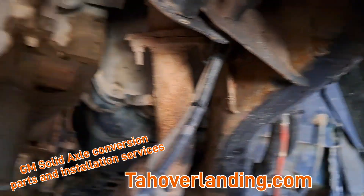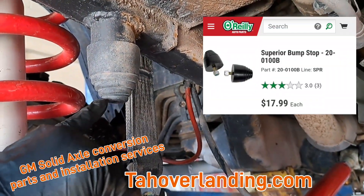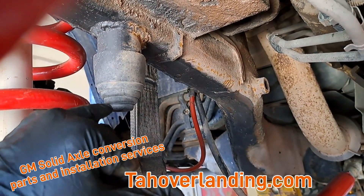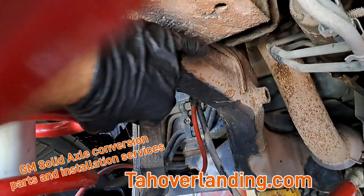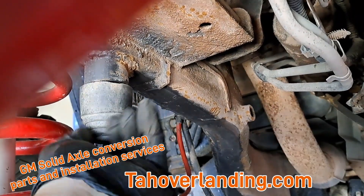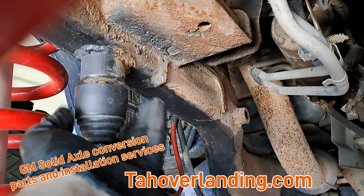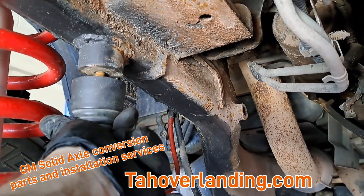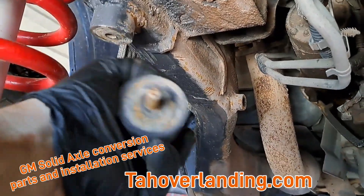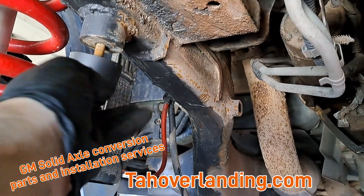You're also going to need bump stops. I like these bump stops from O'Reilly's because they have little steps on them, which means if you ever need to trim them down to fine tune your bump stop, you can trim those steps off incrementally. And the way they're made, they just thread on. So if you ever need to space this out to lower your bump stops, you can stack washers between there and thread it back up.